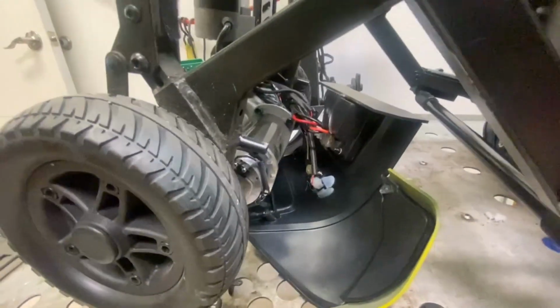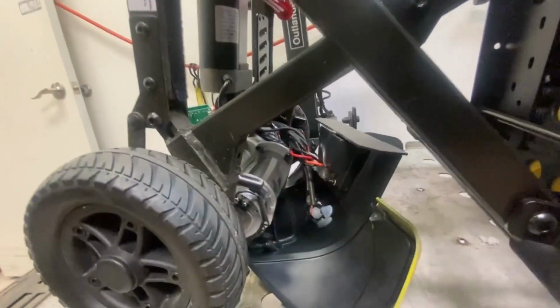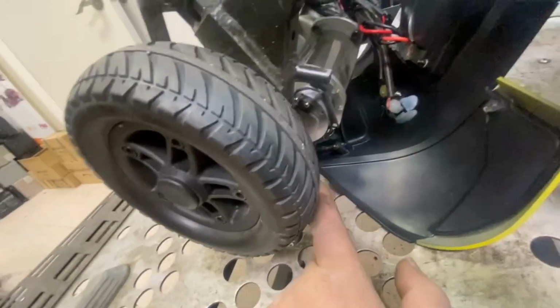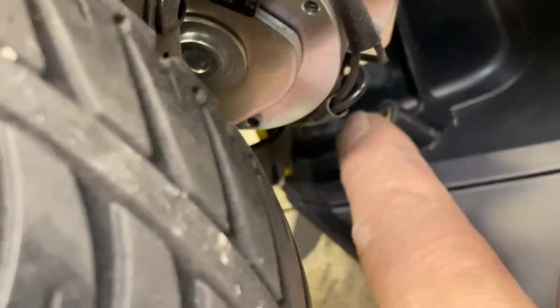So basically what you would have to do if you're replacing either the charge port or the button or even the controller, there's four screws, one there, one there that attaches to the frame just there, if you can see, zoom in there. Yep, one there that attaches there, and two, same on the other side. So you have one on the top there, and it goes to that there, and the same on the other side. So you could release this panel.